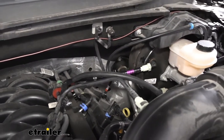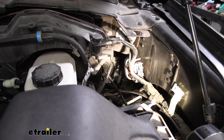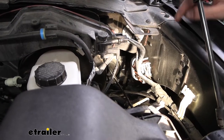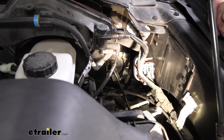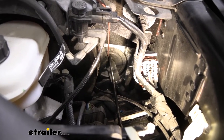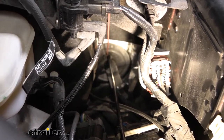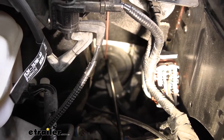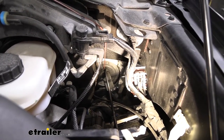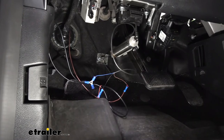We're on the other side of our brake booster behind the airbox. Here's the vacuum line coming from the operating unit that we routed around the airbox. There's a grommet located right down in there next to your vacuum booster - at the top of that grommet there's a little nipple. We just took our razor knife and cut the end of that nipple off so we can poke our lines through. The other side is sealed off as well, so we slit that side too - there's a little round mark there that lines up with the nipple. The brown wire also goes through there to go inside so we can power the reed switch and get our indicator light working properly.